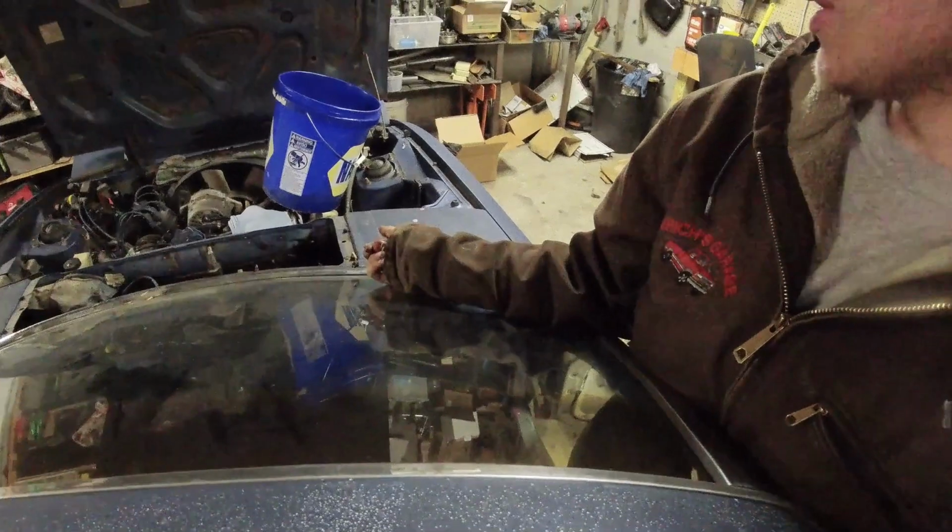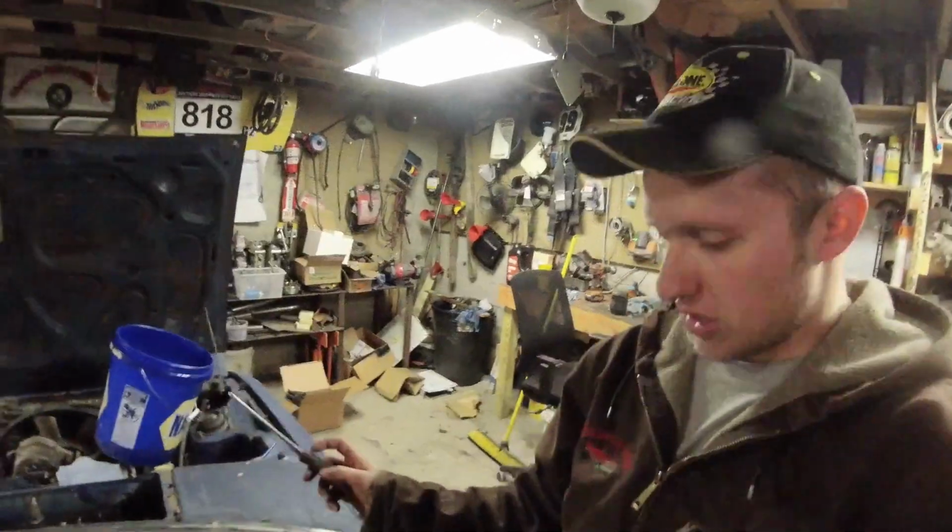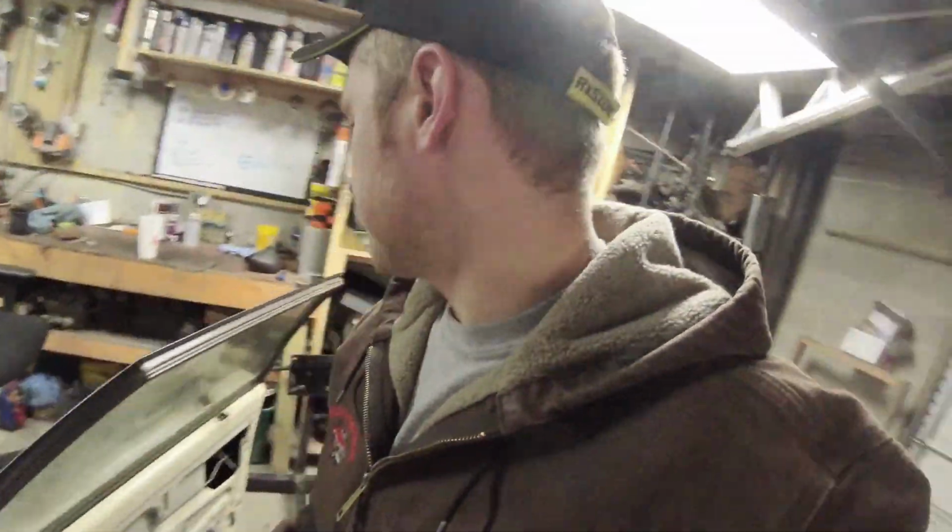So when you have recirculation turned on, it closes this. When you open, you're venting the outside air, it comes in under this piece right here. This wall is spot welded in. I can tell that there's a giant mouse nest of crust and nastiness in behind it. So I'm going to pull out the blower motor, and that should give me access to that from the bottom so I can fish all that stuff out.